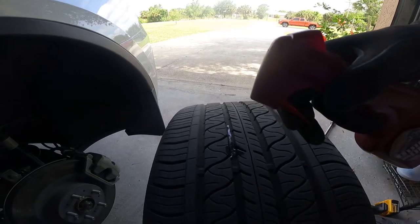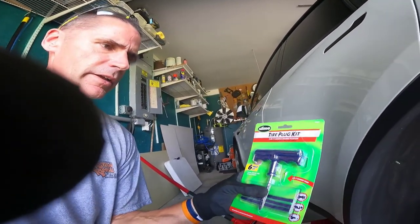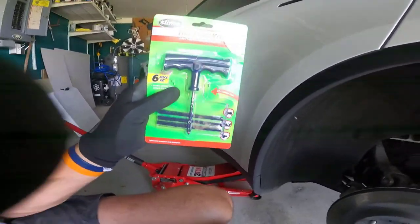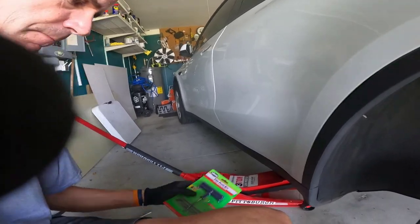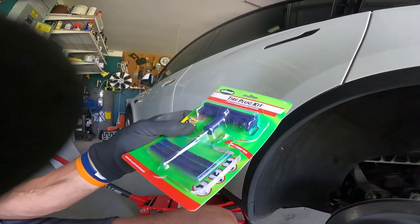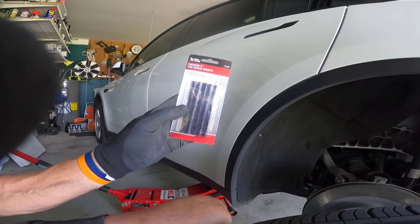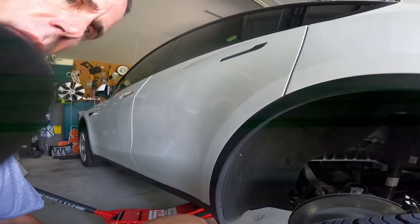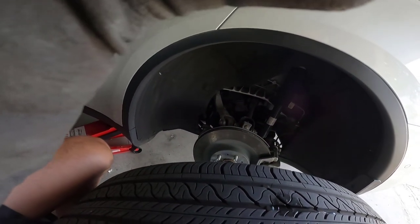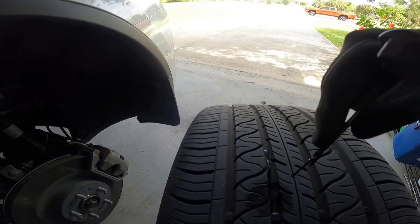Let's pay attention to the other hole — there is definitely air coming out of it. This is how you can tell if you have a hole. So what I'm using is a tire plug kit from last time. It's a tool you use to round out the hole, and then you use these plug strips to plug it. One problem is these plugs can dry out over time, so I bought four brand-new premium plugs just to make sure I have a good set. And let me give the normal disclaimer: I am not a mechanic, and I'm not saying this is the best way to do anything.